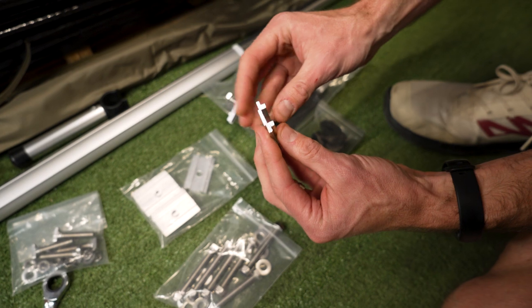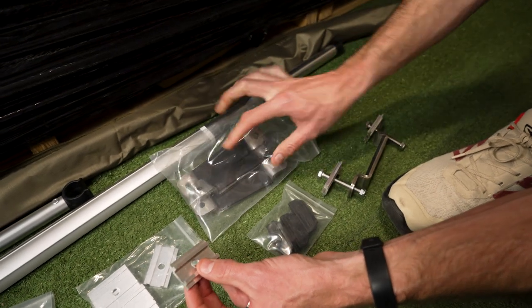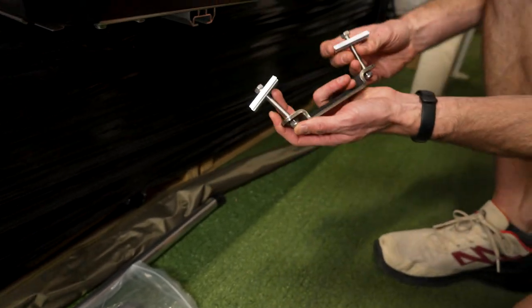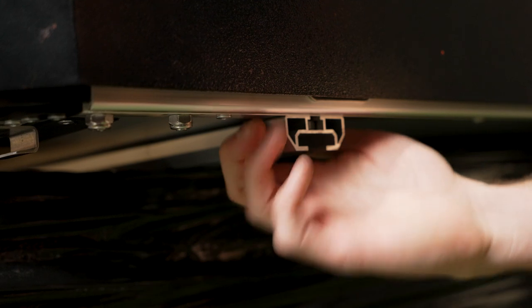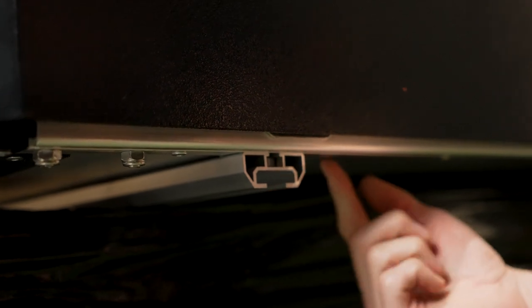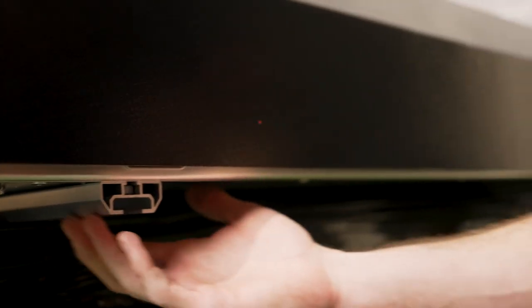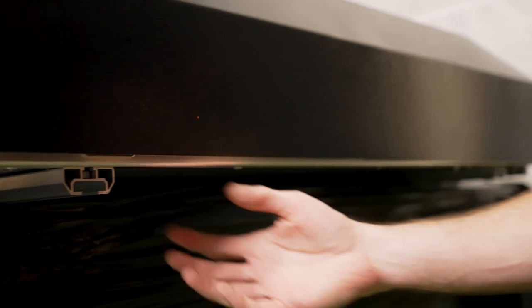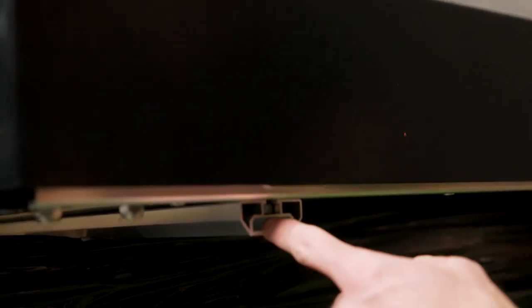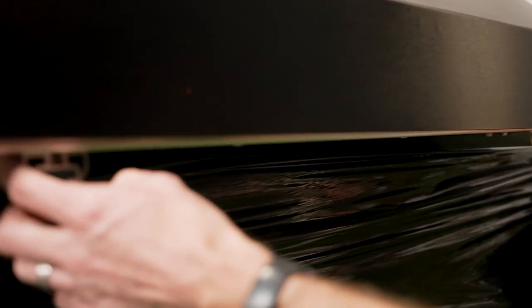There are channels that go inside the rails running underneath the shelter, which combine with brackets to form the mounting hardware. Underneath, you can see aluminium extrusions used to mount the tent — it's not recommended to move these as they're positioned for stability, and moving them could cause the tent to rock or flex. They have 80 centimetre centres from one side to the other and run about 150 centimetres of length.